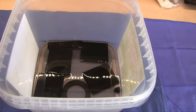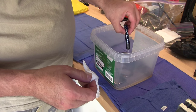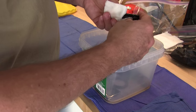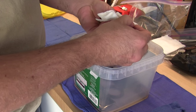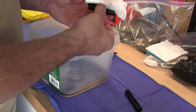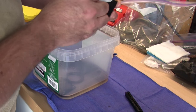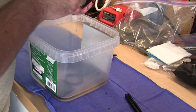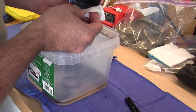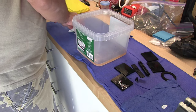For lots of rubber things, I just put a thin layer of Black Wow at the bottom of a container and then lay my rubber in there and let it soak for weeks. This is a foot rest for the bottom rim of a fuel tank — it's in fine shape, not cracked. I'm going to use it again, I just want it to look pretty. These are rubber pads that go on the rear of the fuel tank — 73 and 74 had them in rubber. The actual 76 did not have these rubber pads; what the 76 had were fibrous cushions, kind of like that flame retardant fiber.